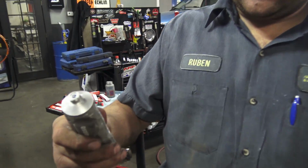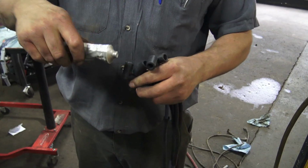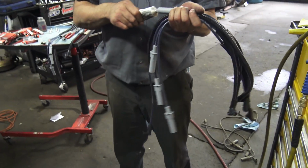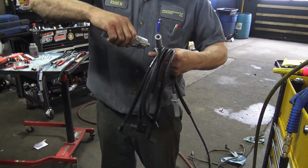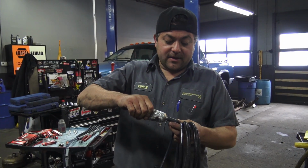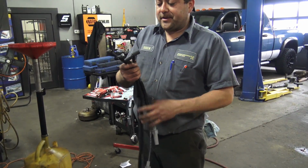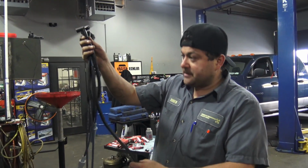Dielectric grease. Oh, okay, Permatex. So you're supposed to add it on each connection there. They say a dab. I put more than a dab. This prevents water getting in there and makes a cleaner connection. Plus, if you ever have to take off your spark plug wire, the boot doesn't seize up to your spark plug, so in the long run you might be able to just change spark plugs and save your wire for another run. Cool.